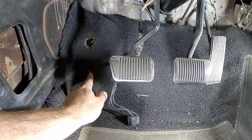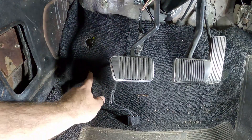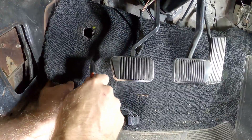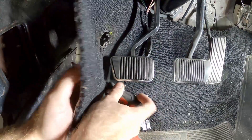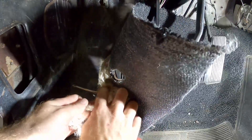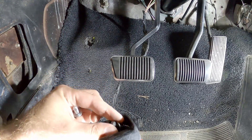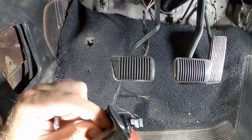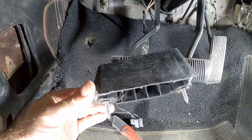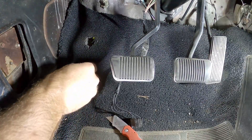I'm going to cut the carpet so I can drill a bit through here and into the sheet metal. I cut through the carpet insulation so when I put the drill bit through, it doesn't catch up all that insulation and spin it onto the drill bit. For the screws, I'm just going to use coarse thread screws because they'll bite the sheet metal and hold it in place. I'm not looking for something structurally sound — it just needs to hold this pedal down to the floor. I'm going to use a three-sixteenths drill bit because that should be enough to drill a hole for the shank of that fastener. So now I want to drill a hole into the sheet metal to get ready to install this.